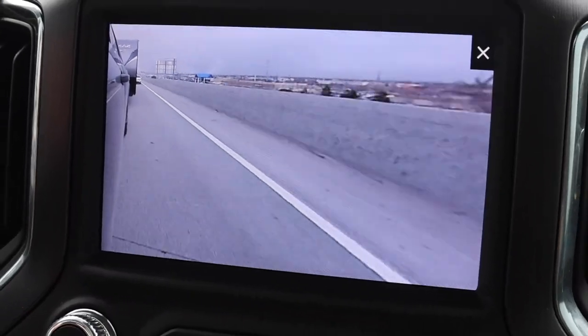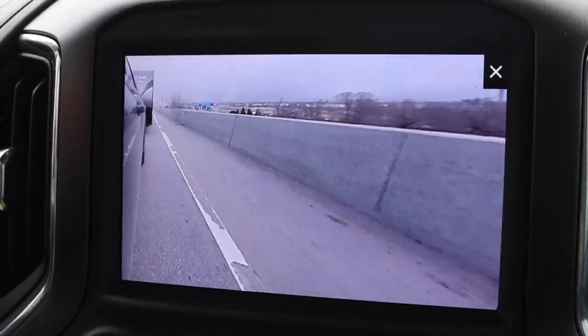All right, so I'm going 77 miles an hour because I wanted to see. Now, what are you guys' thoughts? Do you feel it? Yeah, it's a little sway to me. A little sway. So 1,900 pounds of weight back there lightens up the hitch weight a little bit. And we can clearly tell. Now, we did get the truck weighed without the razor. And yeah, I think that having more hitch weight would obviously make this a little bit better because this is a big truck and hitch weight is actually better for the leaf springs to connect with the bump stops. But I do definitely feel this thing above 70 miles an hour.